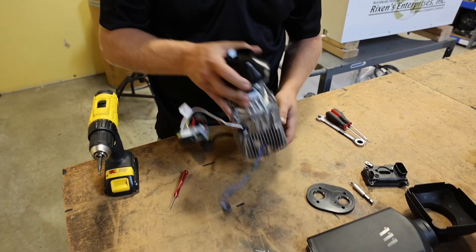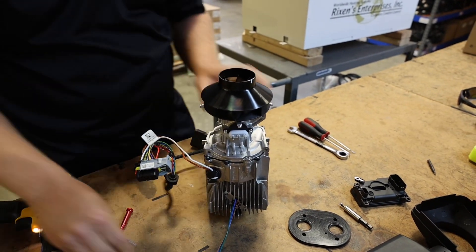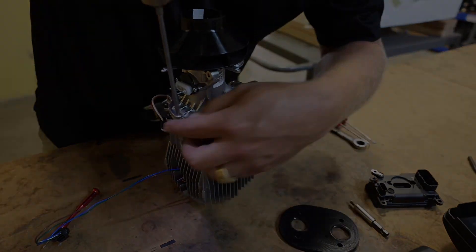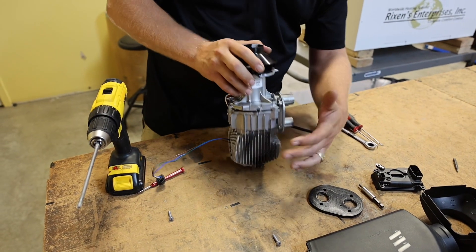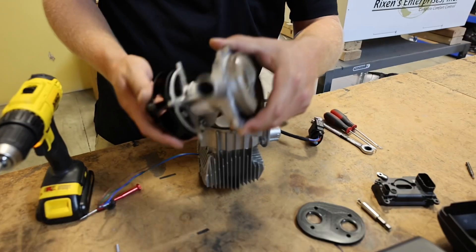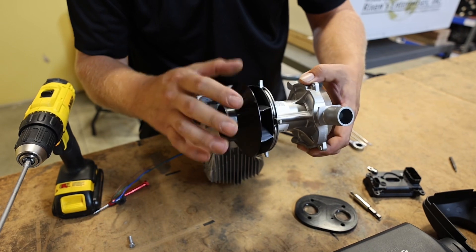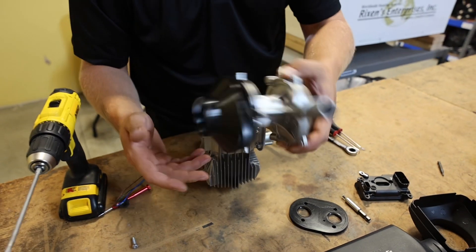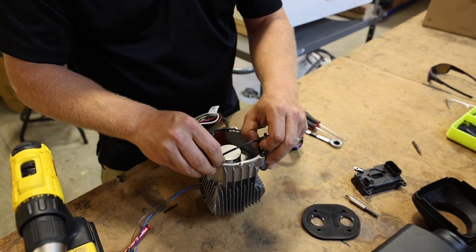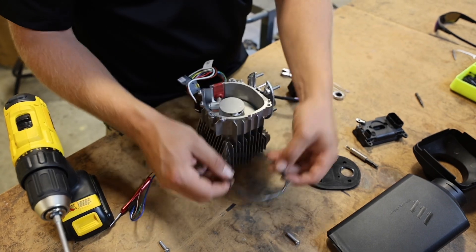Now we've got everything unplugged and the ECU is off. You have three screws — one, two, three — to get this fan unit off. There's a rubber grommet between the heat exchanger body and the fan unit, so you'll just lightly pick up. When you pull this off, you always want to check and make sure you spin the fan by hand and make sure it's not rubbing, grinding, or making any weird noises. If you lightly pull this rubber grommet off, it really shouldn't need to be replaced — it's kind of a lifetime gasket. Just make sure it's not damaged and you don't rip it in the process of taking it off.